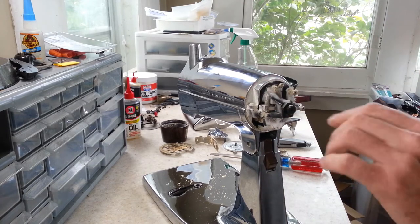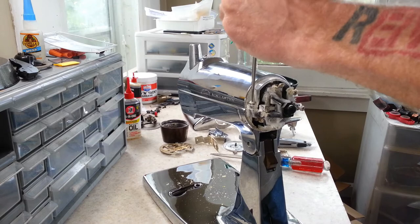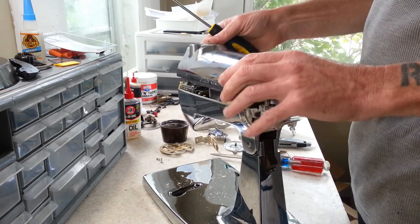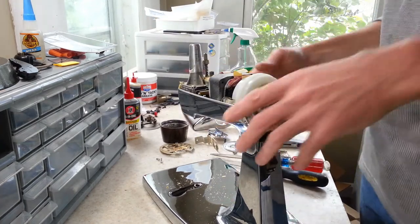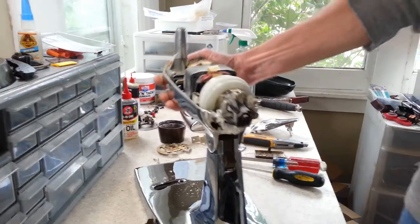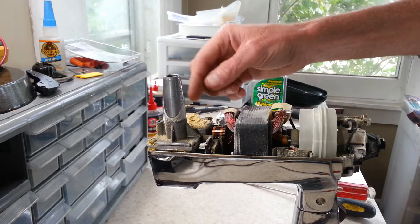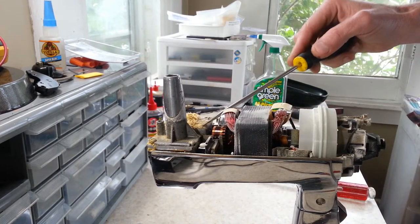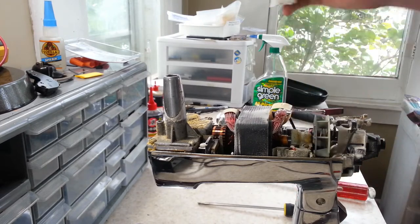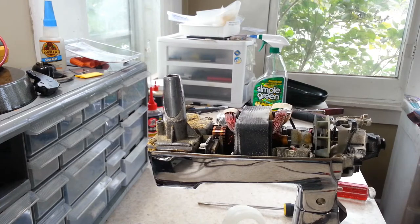It's a completely different style speed control. If you look in here, there's a ramp on here for your speed which runs against this little nub. The on/off switch on these is right here — that's off, that's on. Now we can start separating the two halves — there are four screws holding them together. We'll take this plastic cover top half off. There's a lot of flour build-up here on top of the gearbox which is a little greasy and sticky. There's your fan, a bushing under here, another bushing under the gearbox, and the brushes are right here. We're going to start with our gearbox.